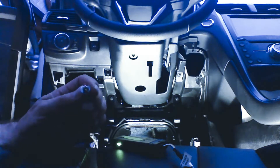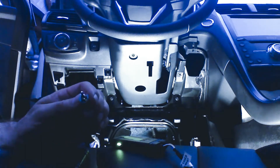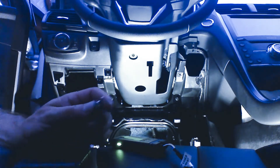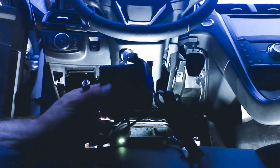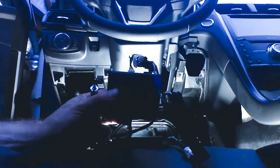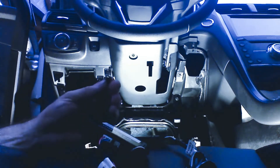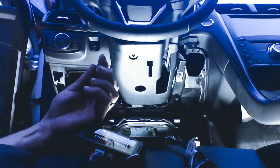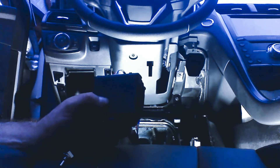On device variations with the toggle switch — if you have the remote starter override switch on and you go to remote start the vehicle and it blinks an error code or clicks, then what you need to do is just switch the switch to the opposite position and go ahead and activate the remote starter.